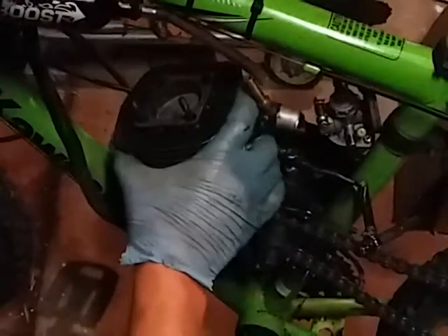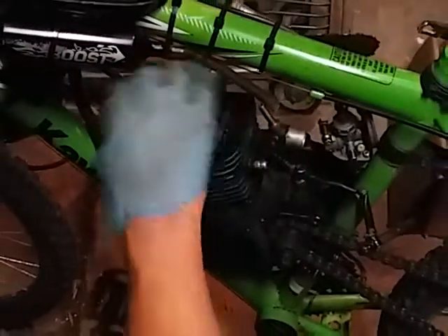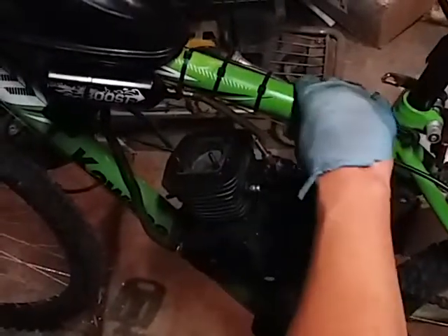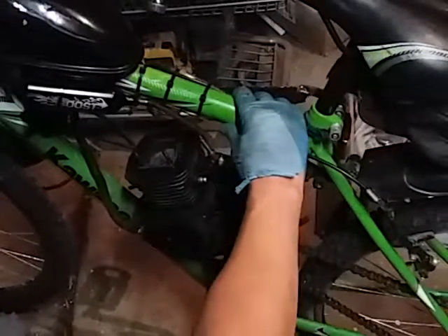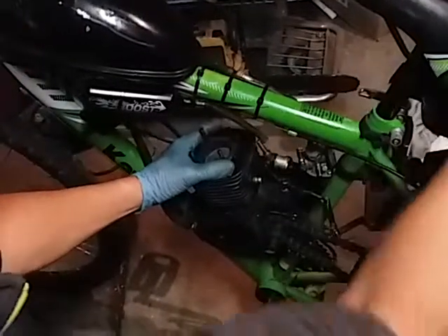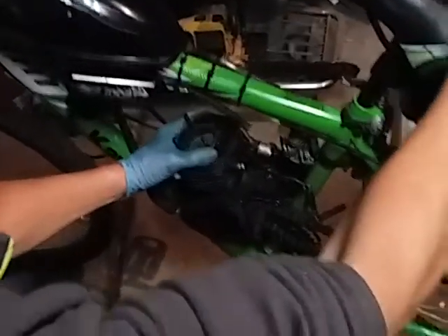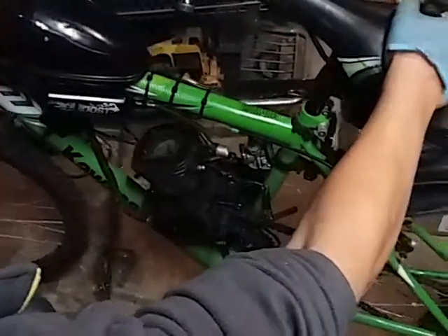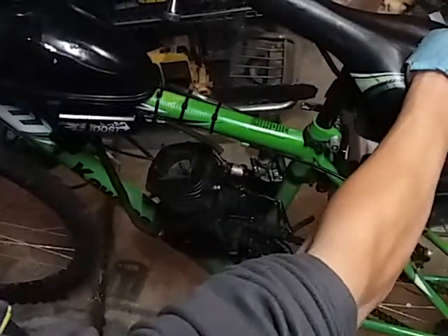It's really a bad scratch on your cylinder wall. Your piston is seized inside of the cylinder. The cylinder is loose now — I took the head off and this should be free to slide right off. See how the wheel is turning? That piston wants to go up and down, and it does, but not when it's attached to the cylinder. The cylinder will not allow the piston to go up and down. When the cylinder is free to move, the piston is free to move up and down.